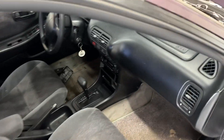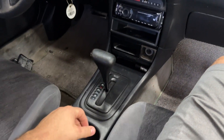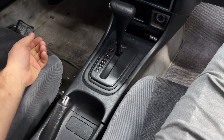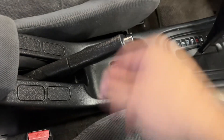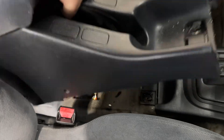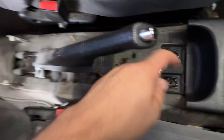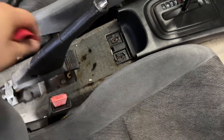First things first, we're pretty much going to start dissecting in here. We have to remove this center console and all of its guts, make sure that we have a nice clean access to this area. This whole mechanism is going to get removed. Obviously, we don't need this, being that we're converting to a K-Series car and stick shift rather than keeping an automatic. This is all going to get ripped out and we'll be putting that shifter in. The kick panel comes off right there, a couple more Phillips. It's kind of gunky down there—I'm going to have to do some cleaning, but that panel comes off relatively easy. Two Phillips heads go attached to that bracket and two Phillips heads go into that little panel. This is full of little trash down there, but good thing we're doing this because we're cleaning up a lot as we go.